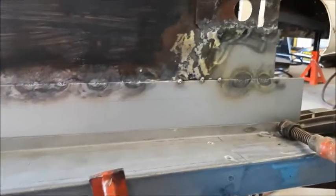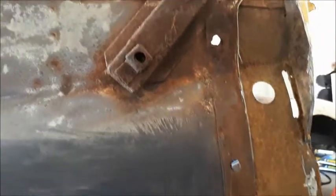I'll go and have a little bit of lunch and come back and finish that off. There was a little repair patch there, and you can see that little bit where the bracket is — a little bit untidy, but the new B pillar goes over that, so we're probably not going to see any of that once it's all welded in and tidied up. There it is tacked in — I'll finish it off and show you how it all turns out.